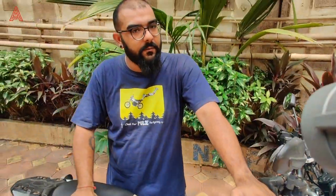Right. Because Gautam, what I've realized is my mechanic, being an Impulse enthusiast himself, he emphasizes that NS gives you good initial torque, while you are saying the NS torque is coming only post 4,000 RPM, the kick. Right. True. Let's see. I think it's also got to do with the way you're jetting your carburetor and probably tuning it in the right manner. Okay. Probably all this while when I had the NS carburetor, my tuning was in such a state that it was only pushing in after the 4,000, 6,000 RPM.